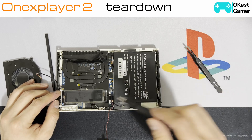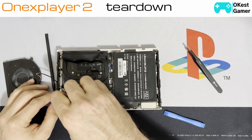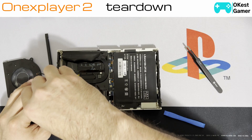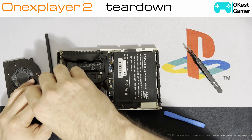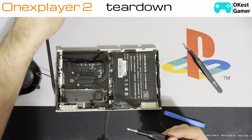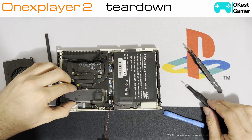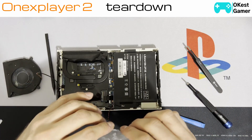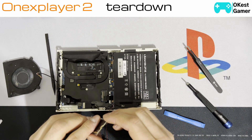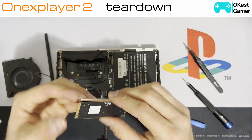For replacing your SSD it's very simple — again just make sure your battery is disconnected. There's a single screw here. Put that aside and you see how this pops up — just lift it and pull it out. You can take this sticker off and place it on your replacement SSD, it's got a little bit of copper on there.